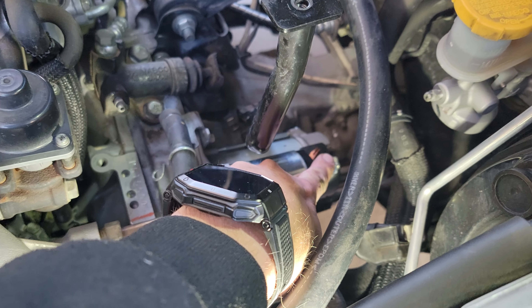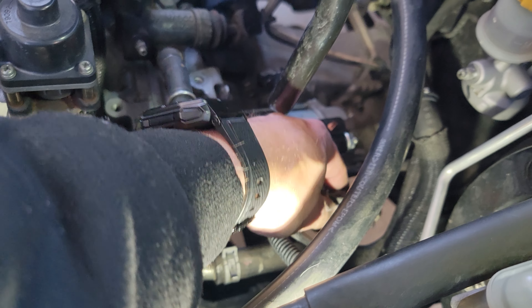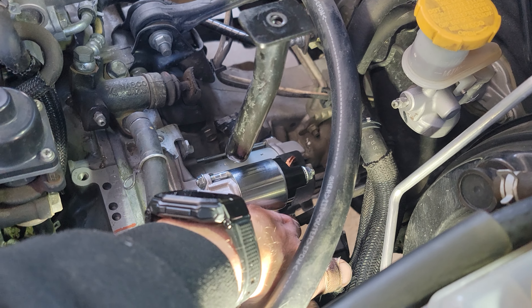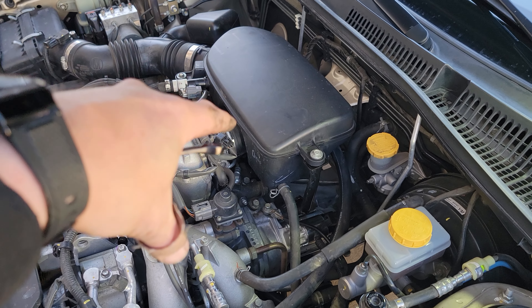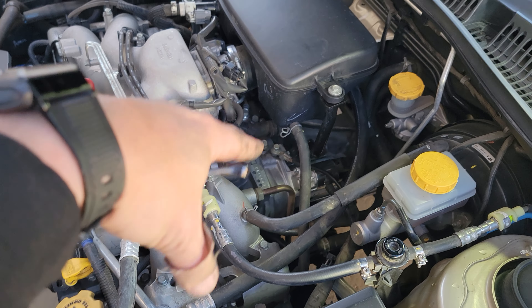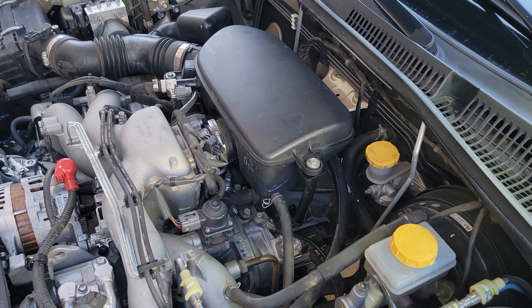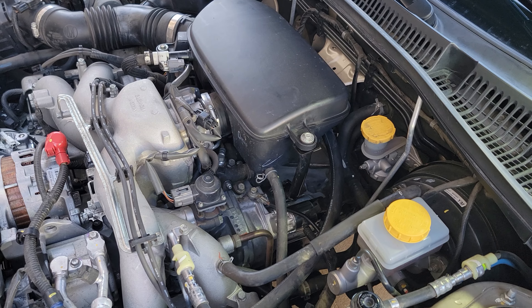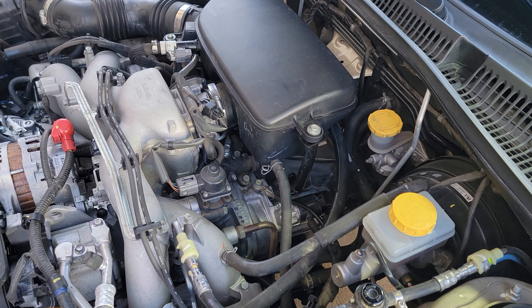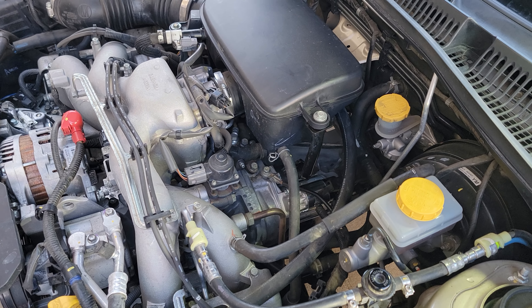The new one came with a new 12mm bolt. Now we've got it tightened up, remove that and connect the lower harness right here. Then there is a little pin connector that we're going to slide on. Removing the air box does help with access, but it is completely doable without it — it only took about three minutes to remove. This process will work also on an automatic; the steps will be almost identical, but the starter itself will be different. I'll link the manual-specific one below, as many people have said they bought the wrong one off Amazon.